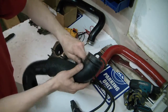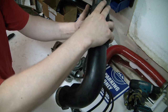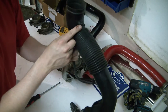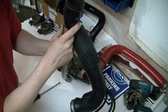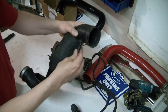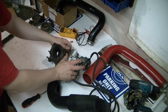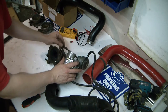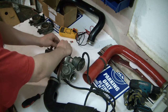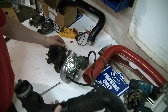The boosted air goes straight from the compressor here. I know of one case where this had been factory-replaced and this hole here had not been drilled open. When you get this from the factory, some of these don't have these holes drilled open on this little bung. That causes all this pressurized air to get stuck here and then travel to the wastegate, causing the wastegate actuator to open the wastegate.